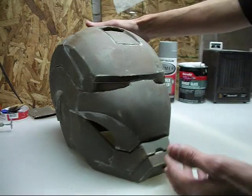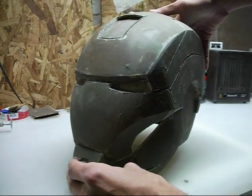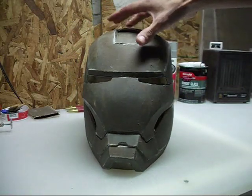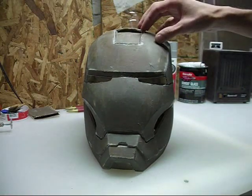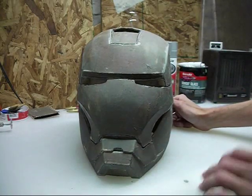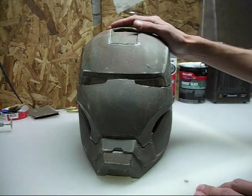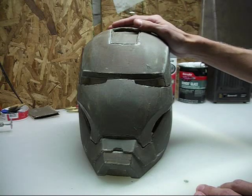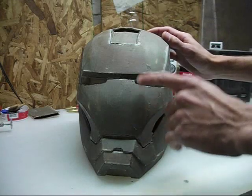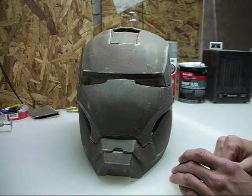For the most part there are a couple little spots where you can see a little bit of paper coming through. You don't have to get every single last area — just get the majority of it. Where it's at now, I've applied a third layer of Bondo, which isn't really meant to do any kind of shaping to the helmet. You should have taken care of that on the first and second coat. The third coat was mainly to smooth out the Bondo work already on there, just to fill in craters, pinholes, scratches, things like that.